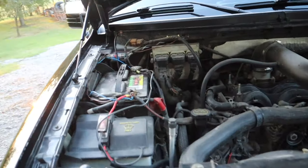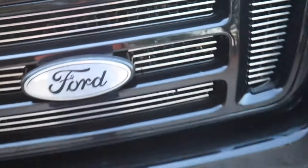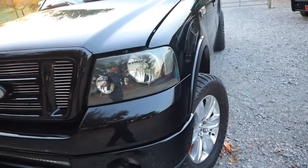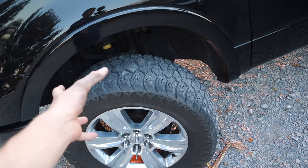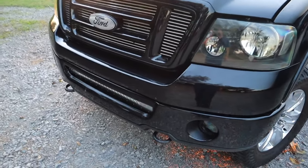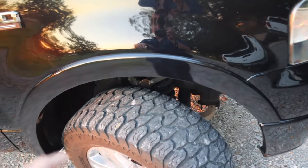Hood's popped. Right there I've got a little cover over mine — most people need a cover because the runoff from the wiper cowl actually runs into your solenoid if it doesn't have a cover, and you get water in your lines. Now, if you get down real low you can see the axle. If you jack one side of the truck up, turn the truck off, and spin the tire — if the axle spins, your four-wheel drive actuator is engaging properly. Those actuators are not easy to change and they're kind of expensive, so definitely check that.